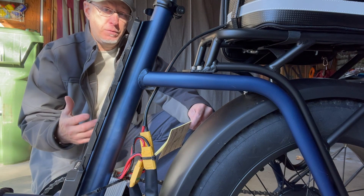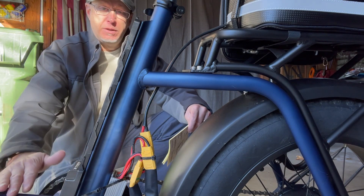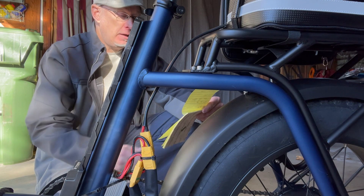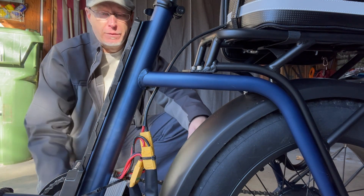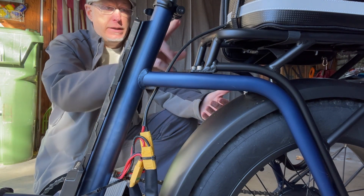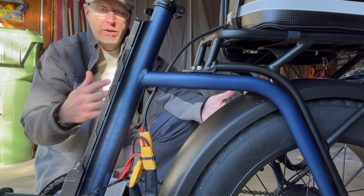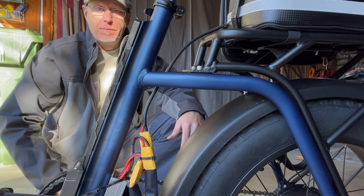This is basically a true plug and play solution since the Espin comes with XT90 connectors already, so it's safer that way as well. You can actually use one battery or both batteries — as I showed, the original battery isn't on right now but I can still run the bike off the new battery in the back. You can unplug them and interchange them. It's plug and play — you can use both or just one.